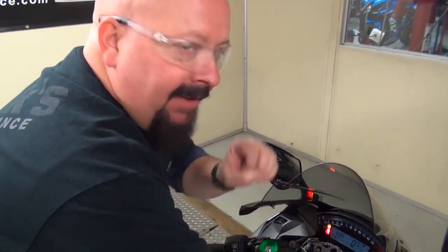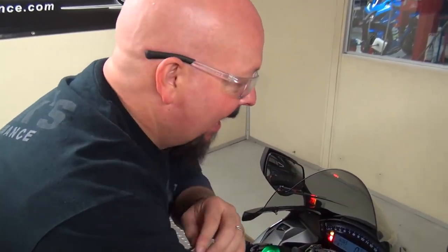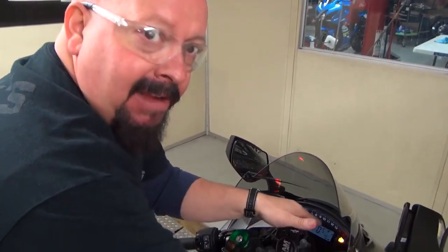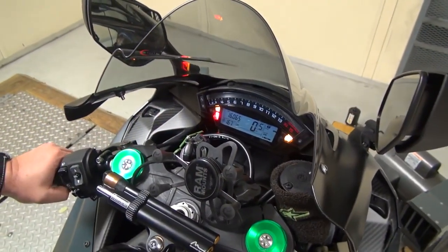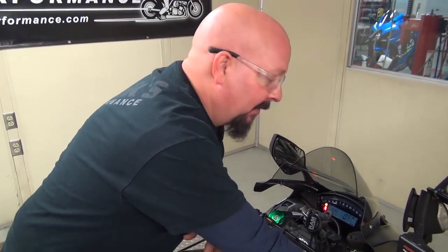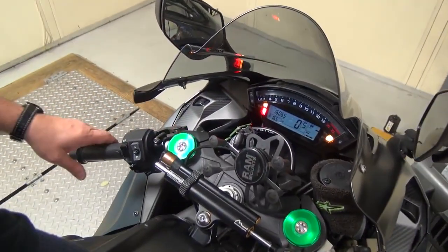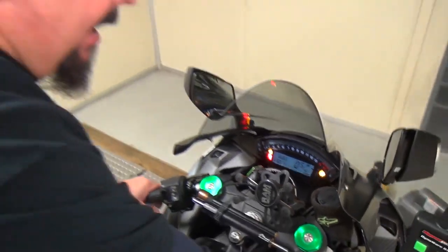Okay, so for those of you who are wondering what was going on, when you put one of these bikes up on the dyno, the front wheel speed and the rear wheel speed don't match, and that can cause the instrument cluster to act funny. I put the bike in fifth gear with the engine turned off, held the throttle wide open, and turned the key on. We had forgotten to mention, these bikes will not run correctly to their fullest potential without a flash. So we worked with Don Ghoul on this. This is one of his Mortify flashes. This allows you to reset the dash panel. You can see those little runs we made were about 6 miles. We just cleaned the filter.